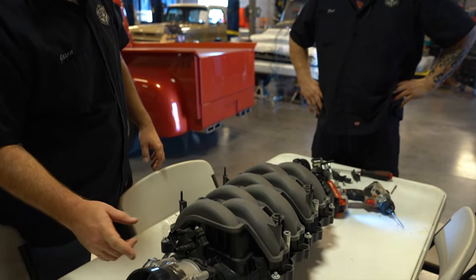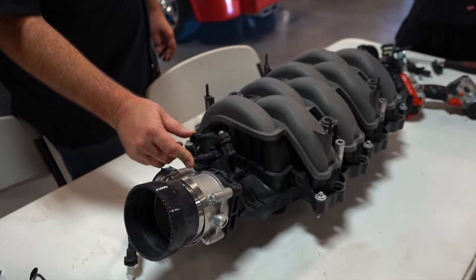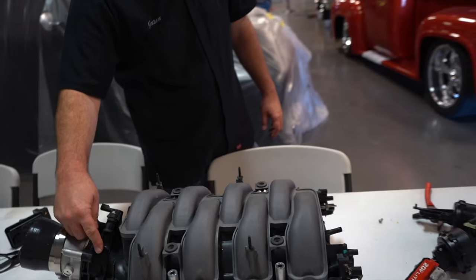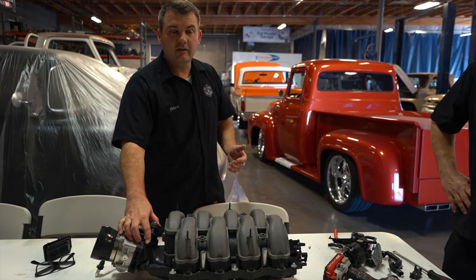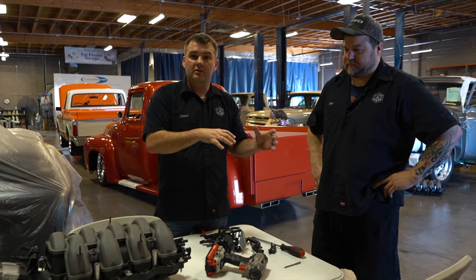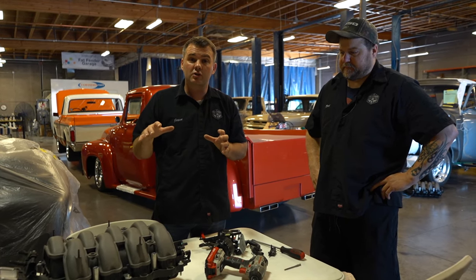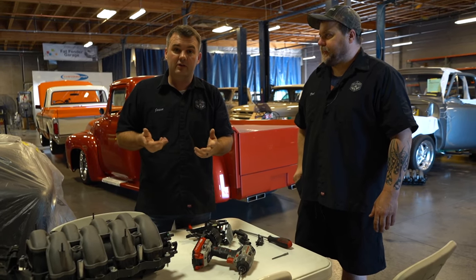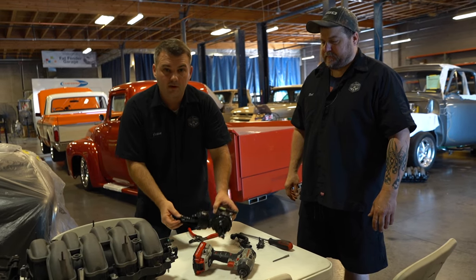This kind of deletes everything up here. If you're not going to use this vacuum port, you're going to cap it off, and you're probably going to cap these little ports off too. The only one you'll probably use is the bottom one — that's if you're running a booster. You can also use this one for a booster if you want. You can go put this back on your truck or car, and it's been deleted. Make sure you have that deleted out of your tune so that when you start to drive it, everything's going to function and work properly, because the computer will see that those actuators are not working and needs to be turned off. It cleans up this back end — you don't have all this extra stuff back there.